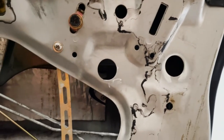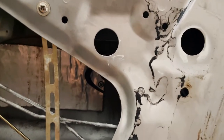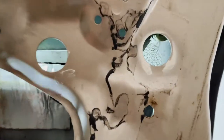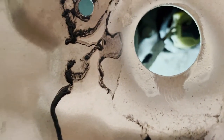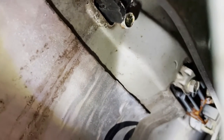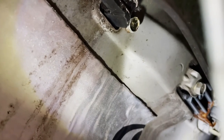This is where things get a little tricky because of the lack of access to the door handle. I'll show you as best I can — putting the torch up through here, you can see the yellow key barrel, and to the left of it there is a 10 millimeter bolt. Coming around the other side there's another 10 millimeter bolt and then another one, so there's three in total that need to be undone to loosen the door handle.